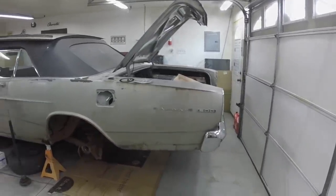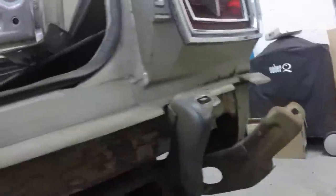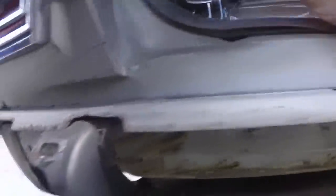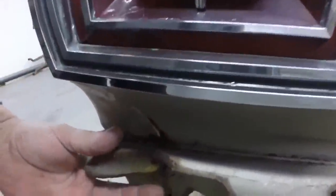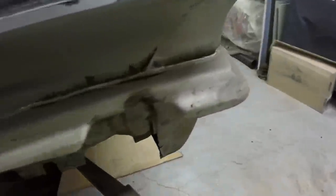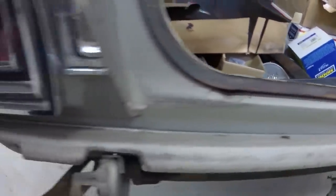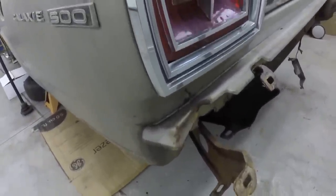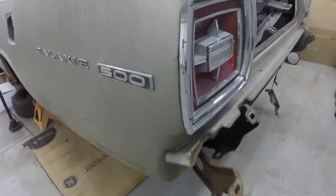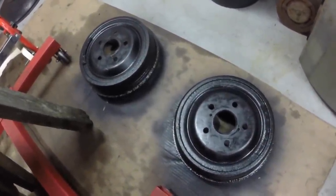I'm going to work on pulling the rear bumper. I got the bumper off — it's actually in pretty good shape under here. Clean all this up. This will be body color, this will be black. Look at the paint still on the brackets. This one's smashed — probably when the bumper got bashed in — so I'll straighten that. The other side's okay, so I know exactly how it needs to be straightened. I'll clean out all this seam sealer and re-seam seal it before I paint it. I bead blasted and painted the rear brake drums too.